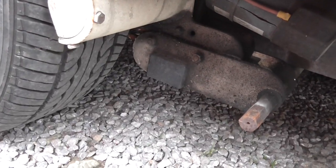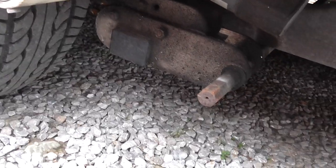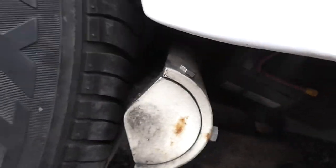And you can operate it from this side or the other side. And a word of warning, when you've used the motor mover, remember to disengage it, because the motors will still be against the tyre if you're towing the caravan. It'll destroy the motors and shred your tyre.